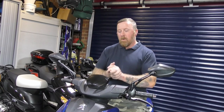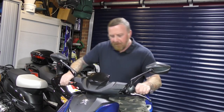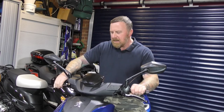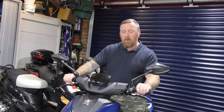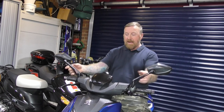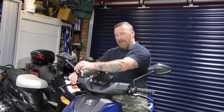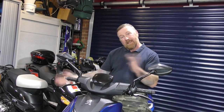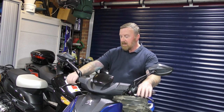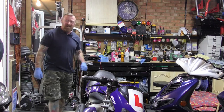Right, I will now wash this, polish it, have a look at the side out in the daylight - see what you think. Front brake felt a little bit spongy again - I just think this has been laid up for a while. It does brake obviously, and the dual braking works well. They're a lot better than they were. I've got to sort this out though - look at that, it could foul the MOT. I think it might have been where he came off because it came down that side and might have bent it. Let's give it a good old clean and have a look. Thank you so much - please like, share and subscribe. I'm out of here.